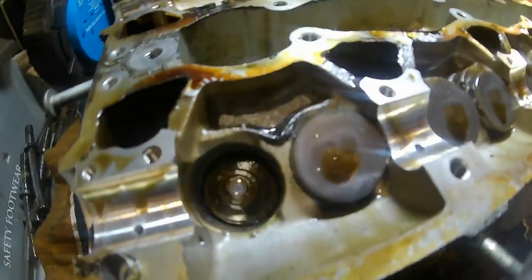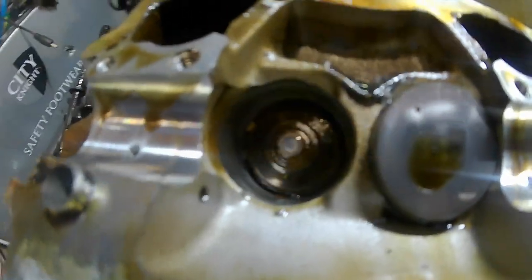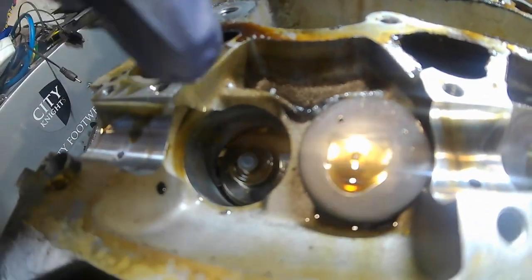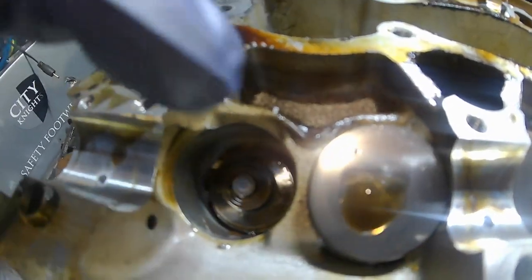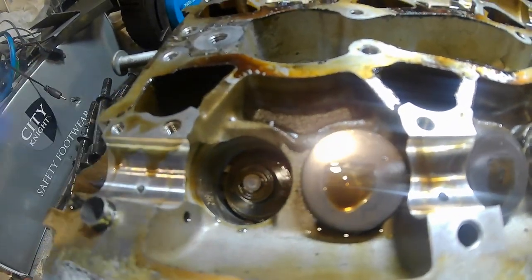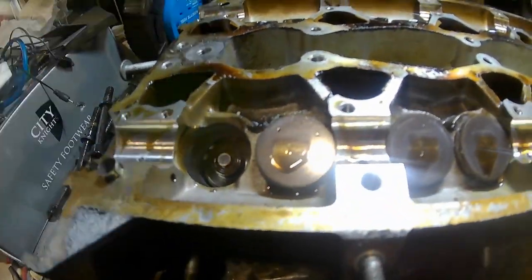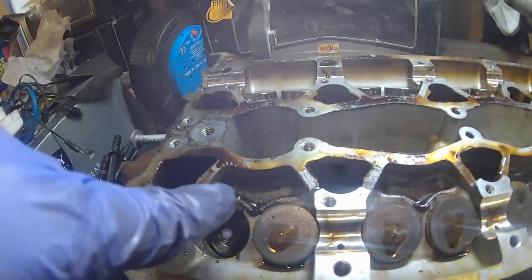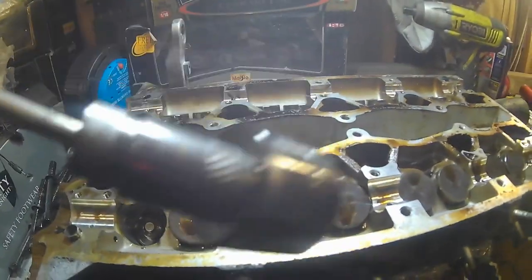And then that's inside one of the bottom of the inlet valve there, where you've got the spring, the collet, and the little keeper, basically, that's holding that all in place. So we're going to obviously need to compress that, push them out, get the pins out, and we can push the valve out, going out that way, basically. So yeah, we're going to get all these out, and I'll come back when I've got all these out.